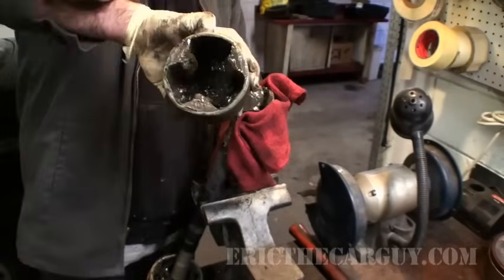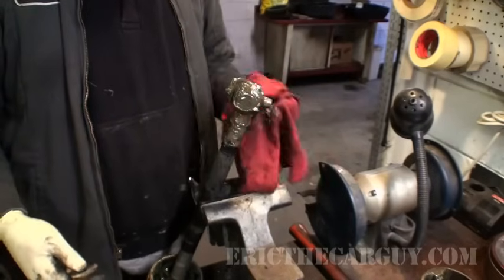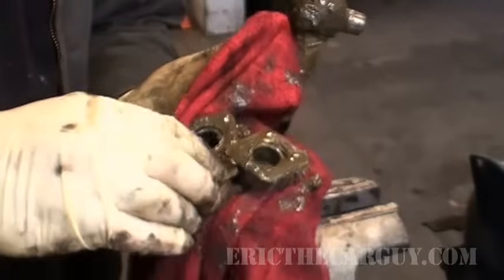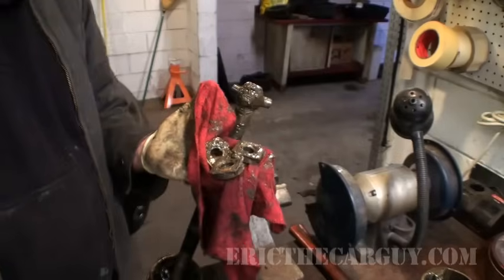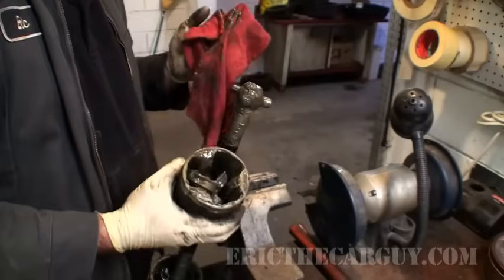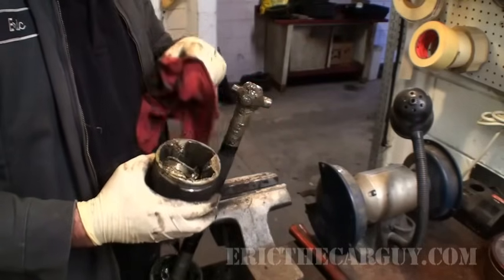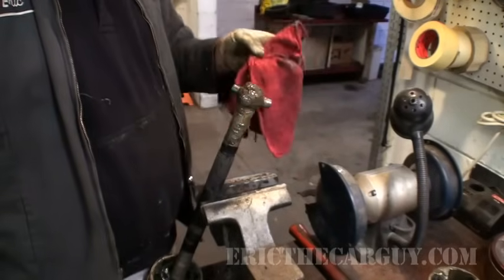You can see the inside of that, way different. So these cups just pull off. These are the actual bearings. This is the heart and soul of the joint. This one has three. Most that I've seen also have three. I take those and just put them into the other joint so I can find them. And of course, in this case, I would also be cleaning out the inside of this really well, cleaning up those bearings really well, and cleaning up the shaft.